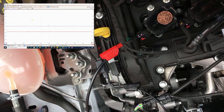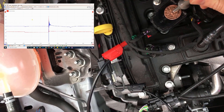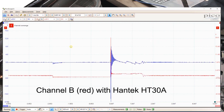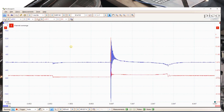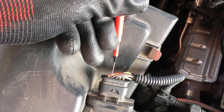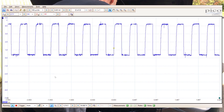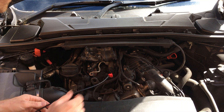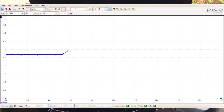This signal is where I had a look at checking an ignition coil with a coin on top of the coil, and channel B is on the primary side of the coil — you can see we've picked up both signals quite nicely. This one here is an air mass meter — this is the frequency modulated air mass signal, and that's quite a good signal. Lastly, we've got a fuel pressure sensor signal, which is a much slower measurement, and you can see a nice voltage change when we increase the fuel pressure by revving the engine. I think you can see they perform quite well.